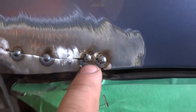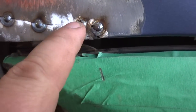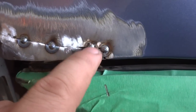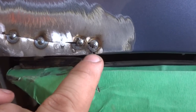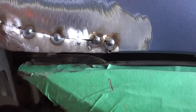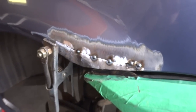You can see right here I've got a pretty big glob. This metal is pretty thin, probably from the rust — we did have that rust section here. When I go to tack weld it, it just burns through. So I'm going to go through again, probably hit this corner, and keep doing this all the way along until I've got beads all the way across. Then we can start sanding and grinding it down afterwards.